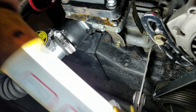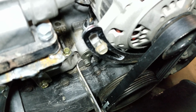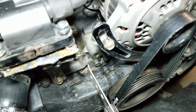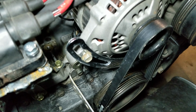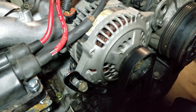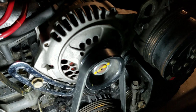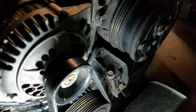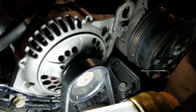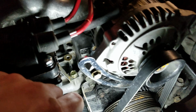The other thing I did that we're going to hit on here: I accidentally threw away the power steering pump, didn't keep it from the donor car, didn't really think about it, and then realized that that's what the alternator goes off of for adjustment. So what I did there, you can see bolted up underneath by the pulley for the AC. You can see I'm missing a bolt there, but I'm not running AC until probably summer, so I'm not worried about that at the moment.